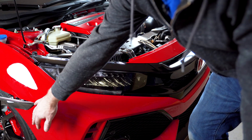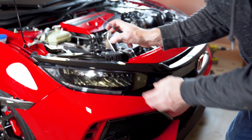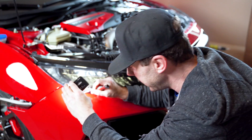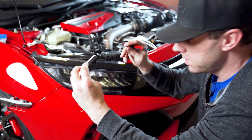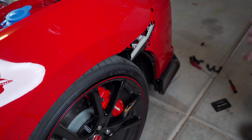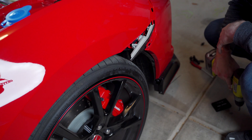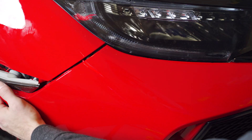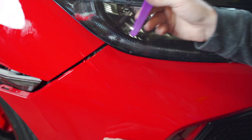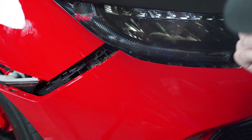We had to get the side parts on the wheel well popped out, but apparently there are a couple more clips in the headlight area. Use a little light so you can see them. For the ones in the headlight, use a small tool and reach up underneath them to pop them up. I also forgot to mention we need to remove some additional screws here — the bottom one needs to come out, but we're leaving the top one. Now we can pull from this side using the plastic clip tool to release things — don't use anything metal because you could mar your bumper.